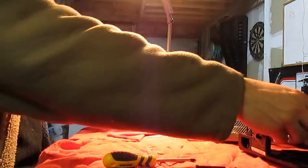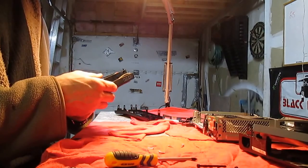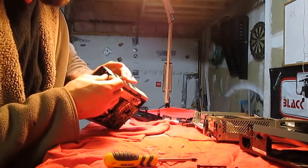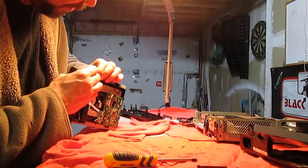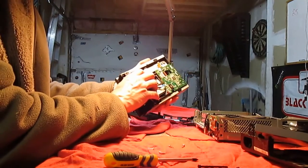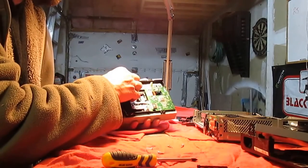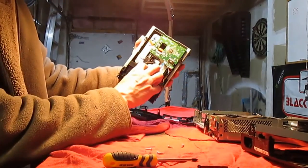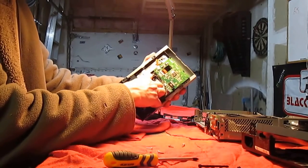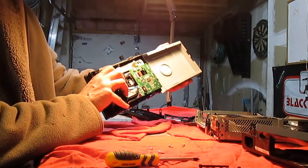Here's the back of it. Let me take the other half off now. So we need to get out the gears. Oh yes, this comes out tricky. What you do is lift this part up, pinch it like this and this, and hook, pull up, and then out, and slide it out of the case, like so.